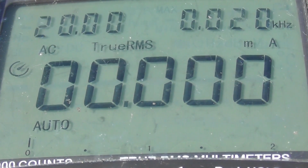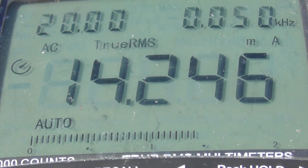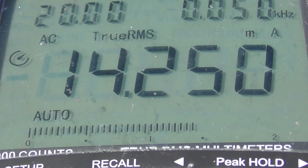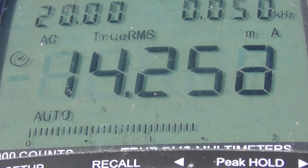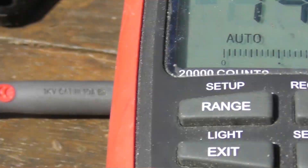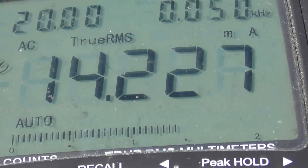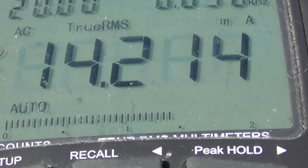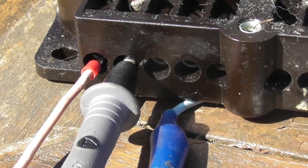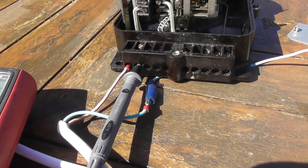We're going to do a quick current measurement on this device — 14 milliamperes, 14.2. This clock is stalled again — I'll let it go. See the difference between running and starting current — it makes very little difference. A synchronous motor normally shouldn't really overheat whether it's running or not. It's running now at about 14.2 milliamperes on this clock. The other clock is doing 13 milliamperes — connected in series with the meter here. So really, if the clock is blocked or running, the current doesn't change much.